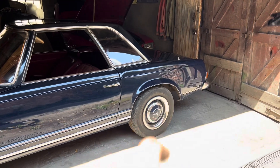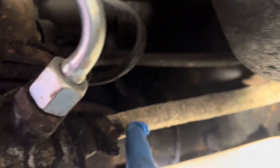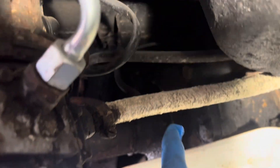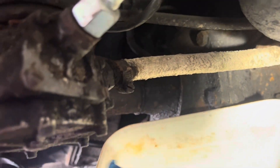I'm under this Pagoda now and we're going to change out this manky fuel pipe. I don't know how long that has been there, but just look at the color and the state of it — it's probably about to go at any time and may even be disintegrating, putting little bits of rubber into the fuel pump. So we're going to undo the fuel hose here and try to catch any excess fuel.